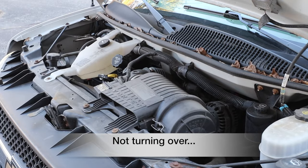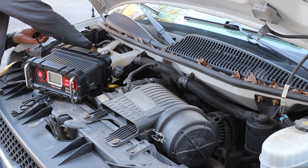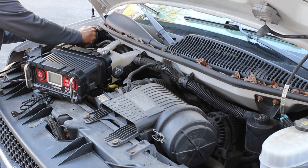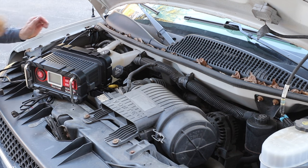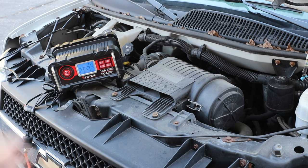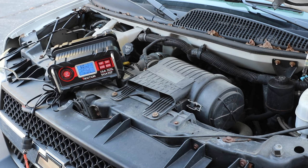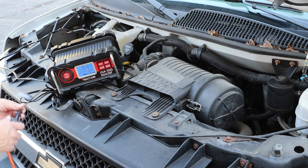This battery will not turn over, so we're going to try the engine start feature. We're going to set the charger here, connect the clamps — looks nice and solid. Now we'll plug it in and try the engine start. It shows how it's connected and usually takes about 10 seconds. You can see where it shows everything's connected properly to the battery. We're going to hit engine start — it has a 60-second countdown that allows 50 amps to flow into the battery. When it counts down to the end we should have some juice to get it started. Now it shows to turn the engine.